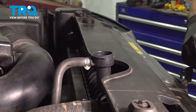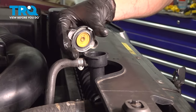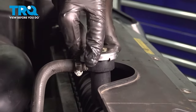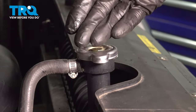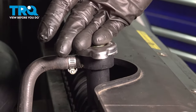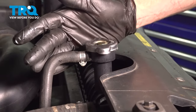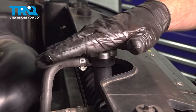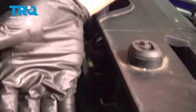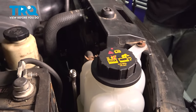Get the funnel out of there. After you've done that, continue on with the radiator cap. Now the next thing you want to do is go ahead and start up the truck. You want to let it run for a little while. Make sure you have plenty of heat coming out of the vents, and then double check to make sure you have no coolant leak, and make sure it's completely up to the maximum line on the overflow tank itself. Aside from that, thanks for watching.